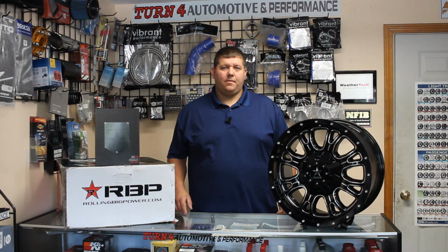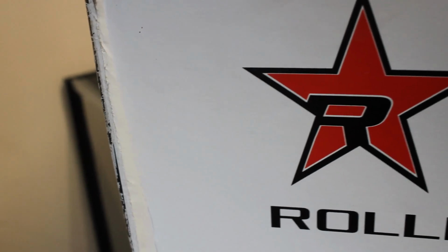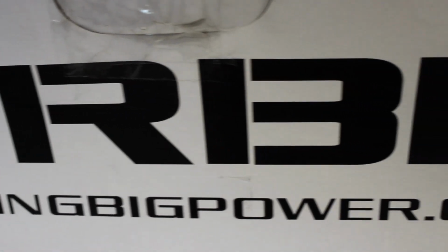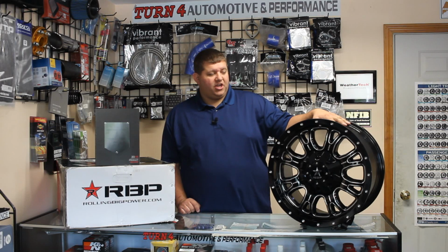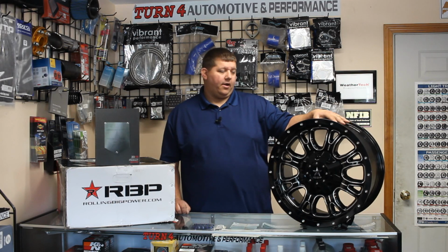Give us a like or a comment about some wheels you want to see us review, stuff that we get here in the shop. We're going to go back where we started. RBP Rollin' Big Power 89R Assassin. This wheel we have here is an 18x9, black with machined accents, 8-lug wheel, 8x165.1, which is your older GM 8-lug pattern.